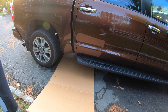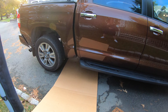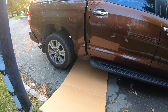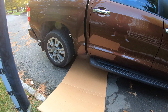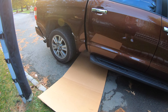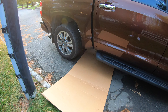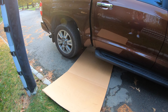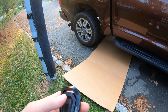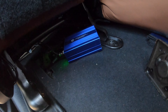I'm going to show you guys underneath the truck. The exhaust system is made by Valvetronic Designs — one of my really good friends started the company, specifically more for performance cars. It does a lot of stuff with BMWs, but we decided to adapt it to this exhaust kit because our exhaust pipe is two and a half inches in diameter, and he has a two-and-a-half and three-inch valve install kit if you don't want to buy a full exhaust system. This is the first truck that he's done. What you get is a controller that looks like an Aventador style — cool controller with an open and close function — and that goes to the vacuum box. I pulled the vacuum box out so you guys could see it.